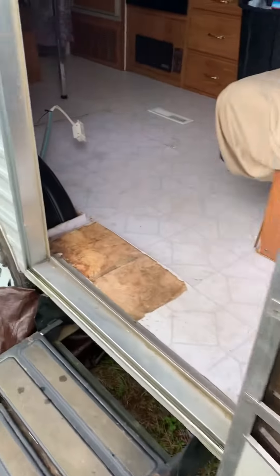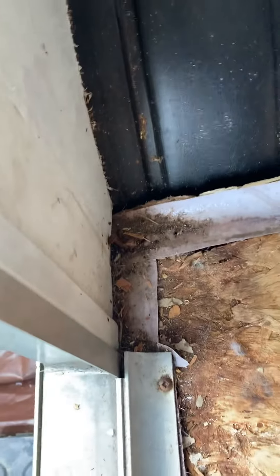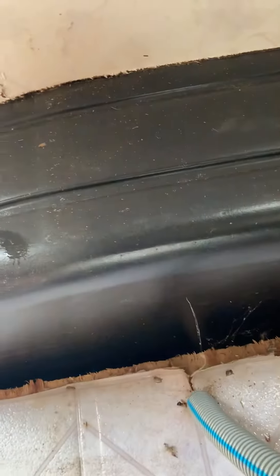But on the inside, if you look, we've got some structural damage, some water damage there. I found out where that's coming from — it's here. There's a crack in the fender well. And then up front here we've got some damage inside of there as well. So I'll be pulling all that sealant out so that we can get it figured out.